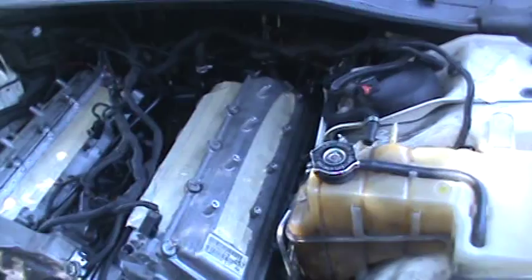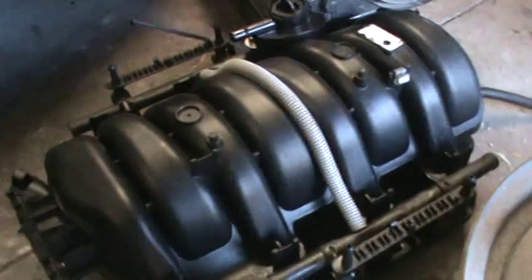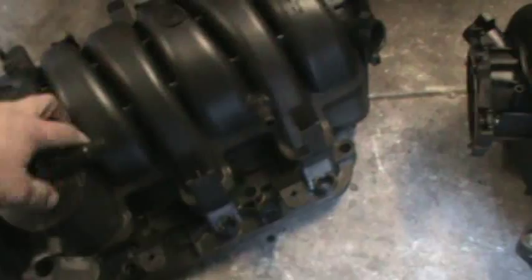We're probably going to have to rebuild this motor since it's so different — the fuel system is different, no return line, just a dead-head-to-the-rail type deal, whereas the other one was a return-line system. Got the Hemi out here with the parts for it. Got the intake manifold — the $400 piece of plastic from Chrysler. I've cleaned this one several times and just can't get into the flat spot of the runner. I submerged it in the safety clean for a couple of days, and every time I rinse it out I get one or two little specks of metal. Those little metal particles are so hard — I don't want to risk a piece getting stuck between the valve seat and the valve.